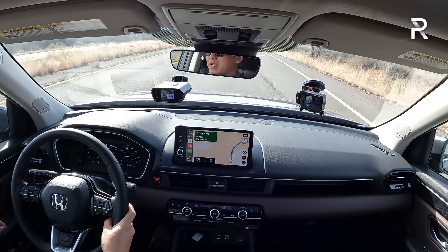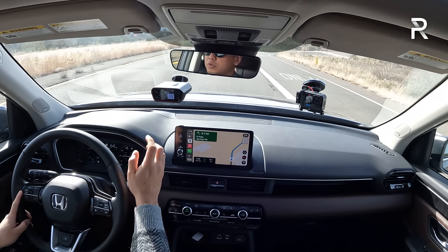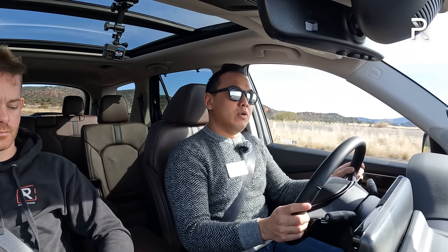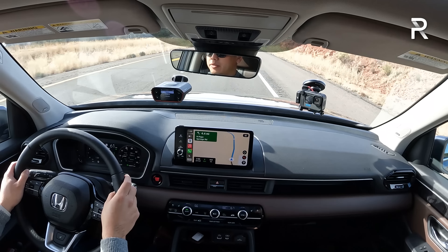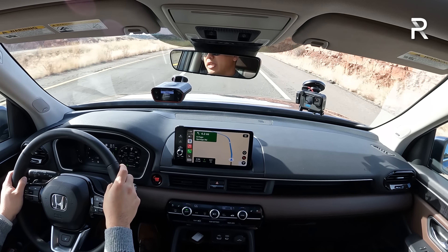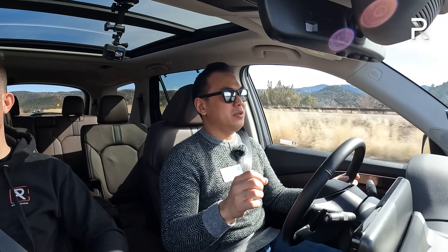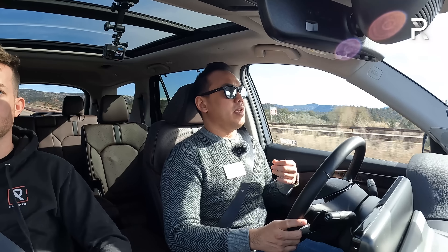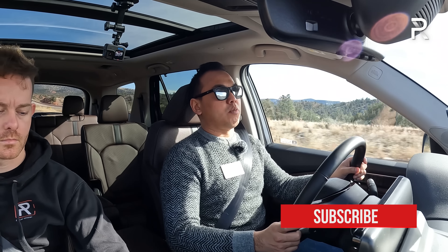We're on a pretty short drive loop. This engine Honda claims is all new, now double overhead cams with a new block, no VTEC, and the same displacement. It practically has the same output as the old engine — 285 horsepower is certainly fine. What is a huge improvement I'm noticing is the 10-speed auto — it's a Honda-designed transmission and it's just far more responsive. When I put my foot down, it has nice smooth shifts. This is still a J-series by the block designation, though it sounds a little different because it's lacking the VTEC. This vehicle is built on a new light truck architecture, which made the structure stiffer and safer, though it also increased curb weight by 300 pounds.